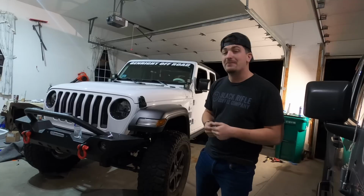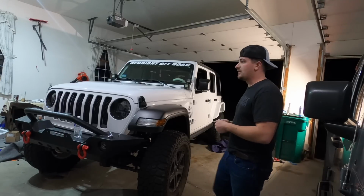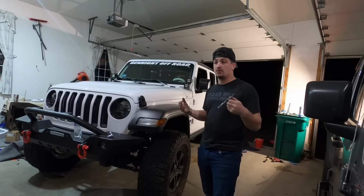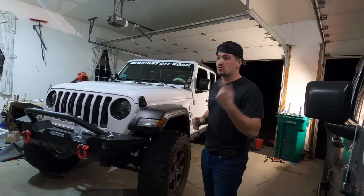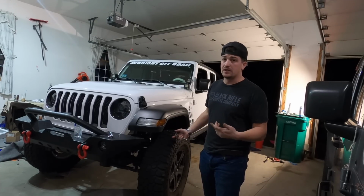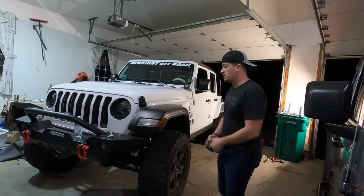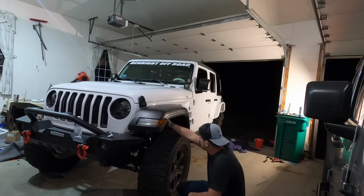supports. They're a 10mm bolt, and there's probably like 4 of them. Anything that's a bolt, pull that out. And then I believe there's one Christmas tree clip that will be holding it in there after that, and you can just yank that. So easy day, we're just gonna remove them all. There's a couple in the front, and then you'll notice them as they go along.